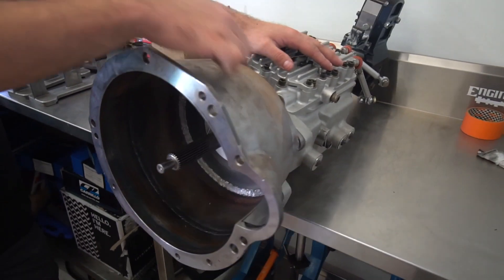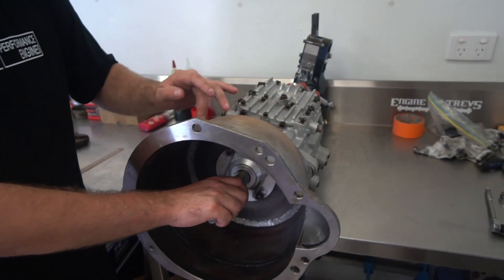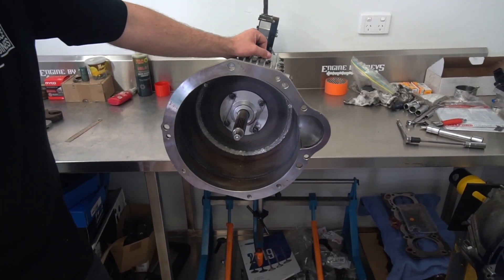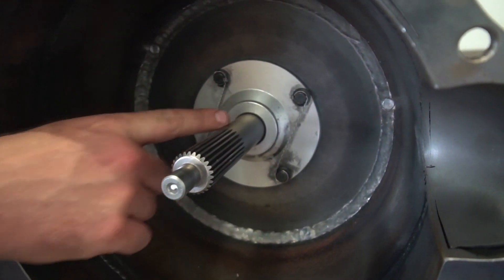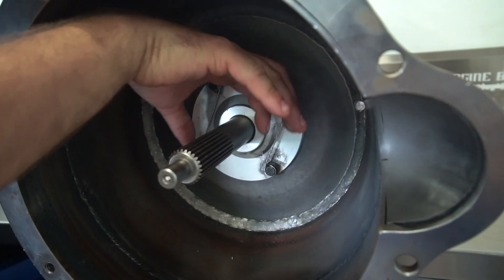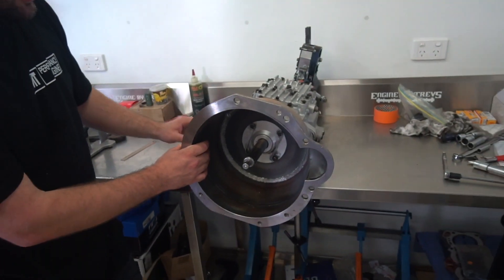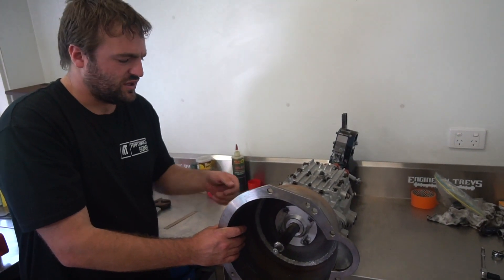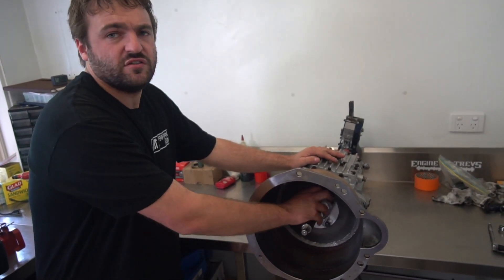I've yet to drill holes for cooling - this is completely sealed at the moment. I'll be drilling a couple of holes in the top to let heat out and tiny holes in the bottom to let any liquid out. There are a few modifications to do inside: I have to change the bearing retainer with one that has a snout on it, then mount a 360-degree thrust bearing for the clutch. I'll be drilling a hole in the side for two lines using a speed flow line with a bulkhead fitting, going to my clutch slave - it'll be all hydraulic.